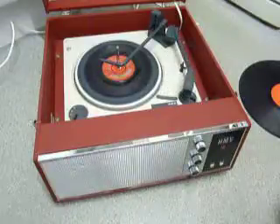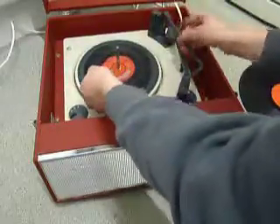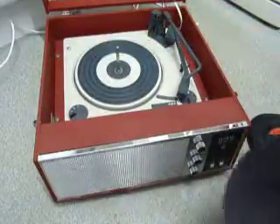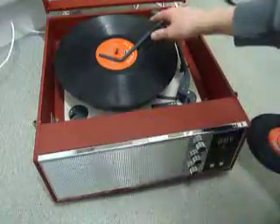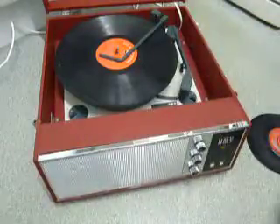I'll just demonstrate now with the start of a 12-inch record. When you stack a 10 or 12-inch record, the black horizontal lever here is the size detection arm. You need to make sure the record is stacked above the black lever so that it trips the lever as it drops, so that the playing arm knows to land in the correct position.